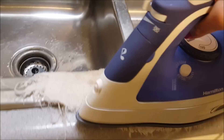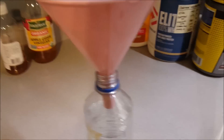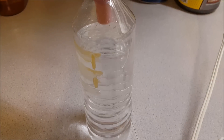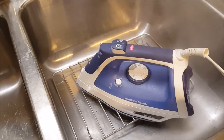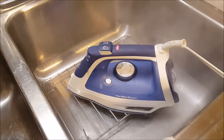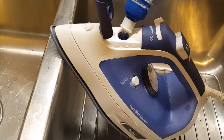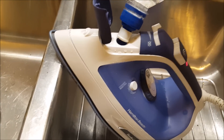I'll put another round in - I think it's taking about three-quarters of a cup each time. It has just about quit spitting out nasty stuff so I think I'm going to run some plain water through it to clean out the rest. I've put some water through a coffee filter and I'm going to use that. I think there's enough vinegar residue left in the measuring cup that the lime in my tap water is not going to hurt it too badly. I need to run clean water through here a couple of times before I use it to iron.